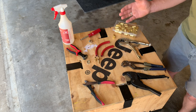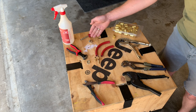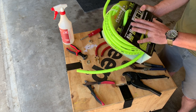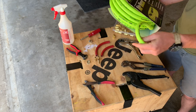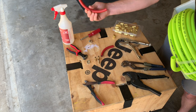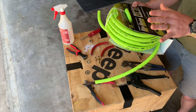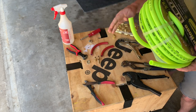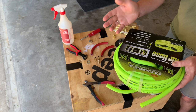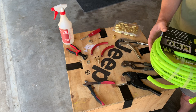When it comes to configuring your air hose system, there's no right or wrong way to do it. You can go very economical, spending only 50 to 80 cents for side crimp couplings, a few extra dollars for hose clamps, or you can go all the way up and do the clean look with the ferrules. I opted for the Flexzilla — it's a hybrid hose which maintains floppy mobility down to negative 40 degrees. This runs about a dollar a foot on a spool. Some places like AutoZone sell it on a big spool; I got 50 feet for around $40 to $45. I'll leave a description below for all these materials.